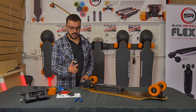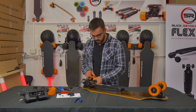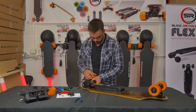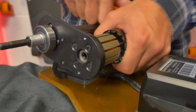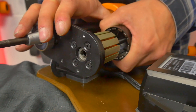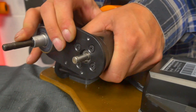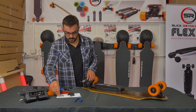Take the new motor casing and slide it around the motor. Keep your fingers out of the way because the magnets will pull it onto the motor, so hold it quite tight when sliding it on. It should slot in and push through — you can see it has some spring in it.